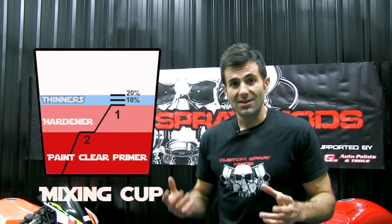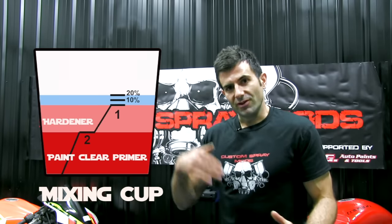Basically that thinners makes the paint thin enough to flow through the gun. It's important to get that correct. Different temperatures determine different ratios of thinners you put into your paint. So we're going to go over how to make sure you've got that all mixed up and correct so you get the best paint job you possibly can. I'm going to hand you over to Dave, he's going to tell you that now.